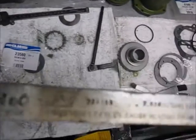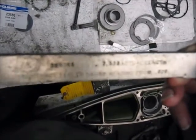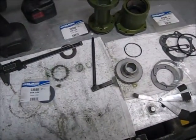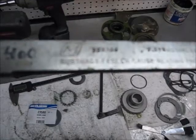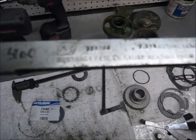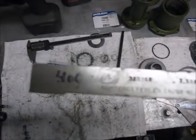This is a shim gauge. What it reads is seven decimal five — I'm getting about 7.511 off of it. The OEM number, if you want to buy this tool, it's 32-83-66. Whatever your reading is off of this tool, you subtract that reading from 20 thou — that's what it says there.